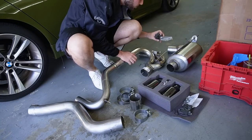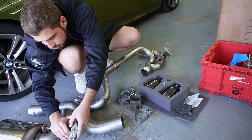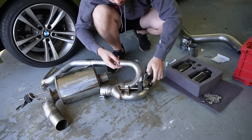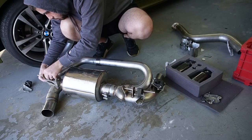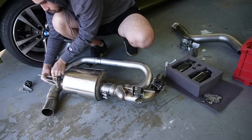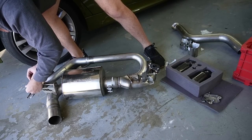Now theoretically, if we cut the muffler right in the last video, this should be able to be a plug-and-play, and I'm really hoping it is. Otherwise, we're gonna have to get it welded up. So fingers crossed — it's a direct plug-and-play and hopefully it'll be pretty easy to install. I wanted to fully assemble the exhaust before actually putting it into the car; I feel like it's gonna make life a whole lot easier. So I transferred the exhaust hangers from the original exhaust to this one, then started putting on the clamps and screws. I didn't tighten anything — just to mock up where everything's gonna be so when I actually install it, I don't have to fish screws or clamps in. Everything is where it needs to be, then I just adjust, tighten it, and it'll be super easy to install.